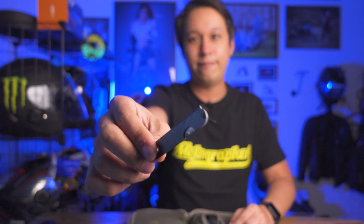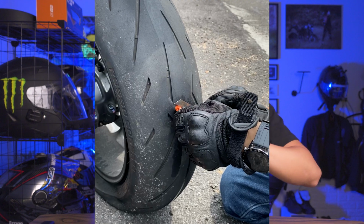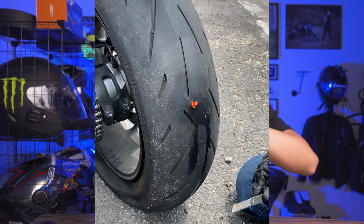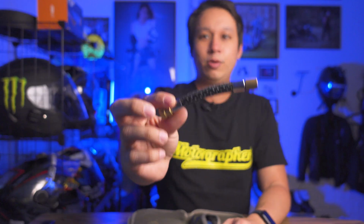And then, a penknife, just a sharp blade. This is to trim off the very long excessive part of the worm. You do not want it to be pulled out by the tarmac, so you cut it shorter, and then you'll be on your way.